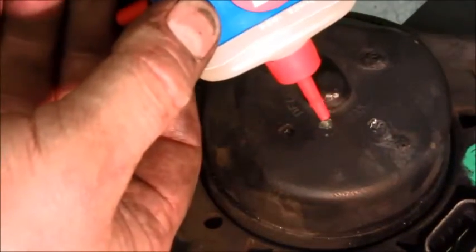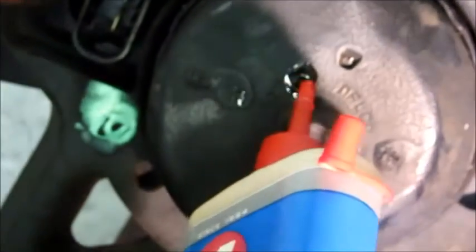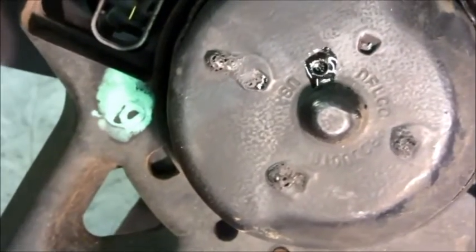I've got the oil tip cut off about the same size as the drill hole. Just give it a good healthy squirt. The motor brushes are in the other end of the motor, so you don't have to worry about soaking the brushes with oil unless you went way overboard with it. I like to turn the new oil hole to the up position so that the oil runs down into the felt. Give it a good solid squirt — you can see it's still soaking in. Now it's slowing down — I guess it's going to be plenty. Give it a spin.